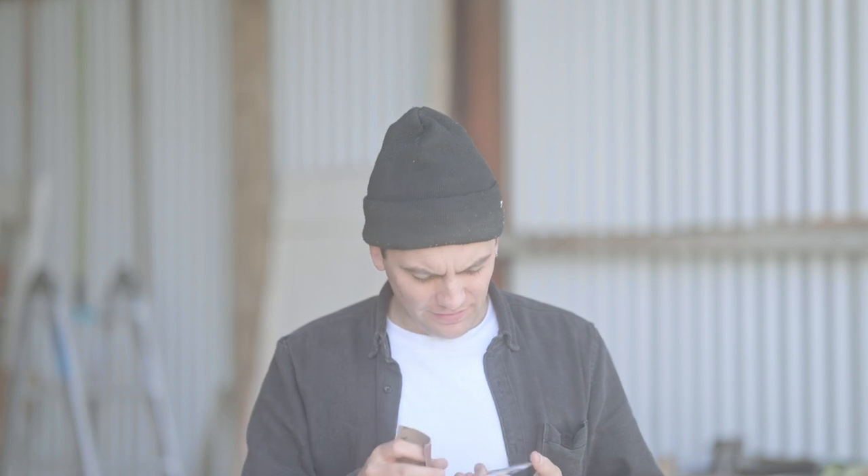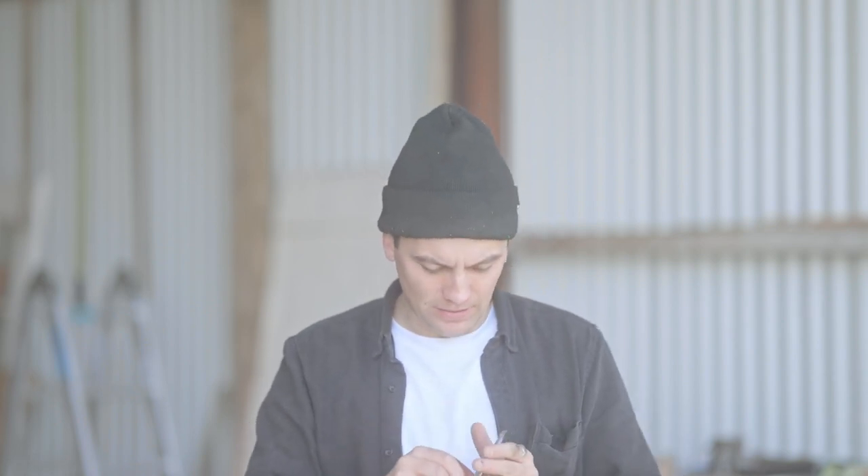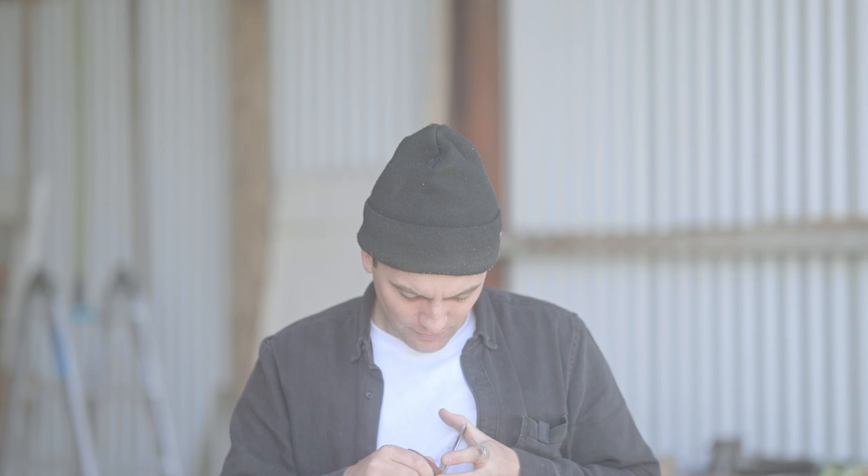Then I'm going to take all of the tape off the van and do the big reveal. This badge is one of the things causing me some trouble when I painted it last time. I've taken it off and I'm going around with some 120 grit — quite coarse sandpaper — basically scuffing it up so the paint will get a better grip on it.